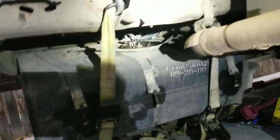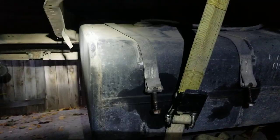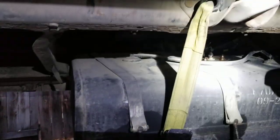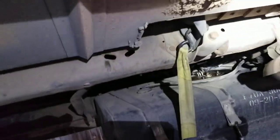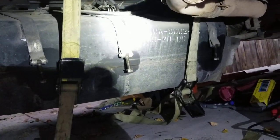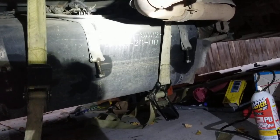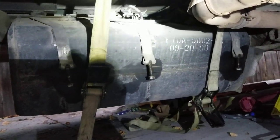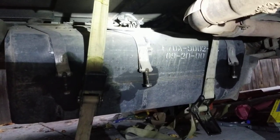I'm not going into great detail — there are several other videos on YouTube about how to get your tank down and pull the pump out to replace or repair it. I like the idea another person had on YouTube of using straps to hold the tank while you lower it. You can also use a floor jack, but straps allow you to move it sideways, whereas a floor jack keeps it flat. Putting it at an angle I think is going to work better to get into the parts I need to work on.